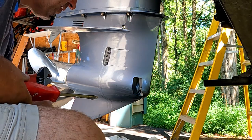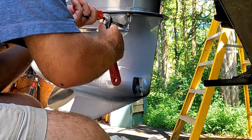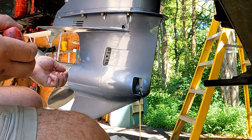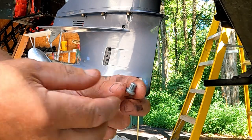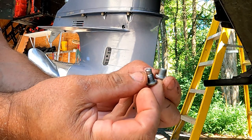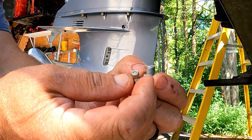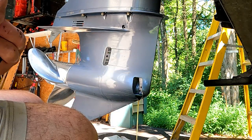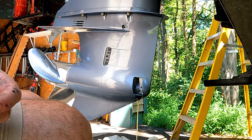Take the top one out. Now, as soon as you open this top one, you're going to let air in from the top and all the oil's going to come out. The top one's a little different — it doesn't have the magnet on it, so it's easy to keep them separated. The one with the little nub, that's the magnet — that's the bottom. The top also had a little washer on it that I'm going to discard. We'll be replacing both of those.